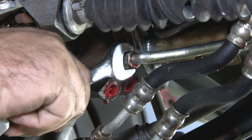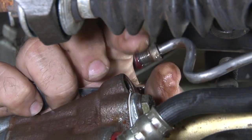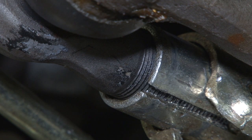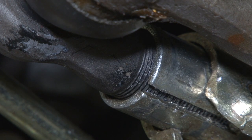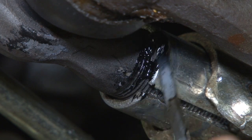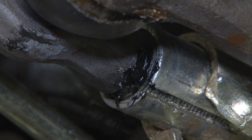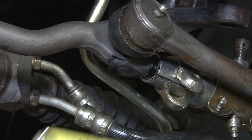Now we're gonna do the power steering lines. Before you unthread the control valve, you want to mark its location so the new one goes on the same spot. I recommend doing it — I'm actually gonna make a mark with paint here so I know how far threaded on it was. I'm also gonna take a measurement to double-check. I'm gonna measure from the grease fitting of the inner tie rod, which is nice and easy because it's exactly an inch and a half to my control valve.